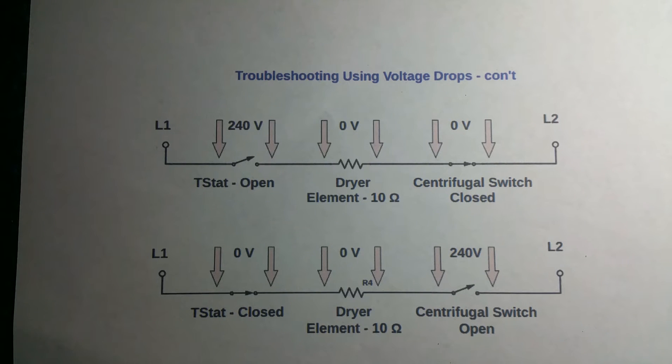One way you can test it is to use voltage drop checks, and I'll show an example of that. Relay contacts: when relays are not functioning and the contacts are really open, you're going to get either voltage across the contacts or more voltage than you should. Another advantage is that in some cases you don't need to remove a component to test it — you don't have to remove anything when you do voltage drop checks.